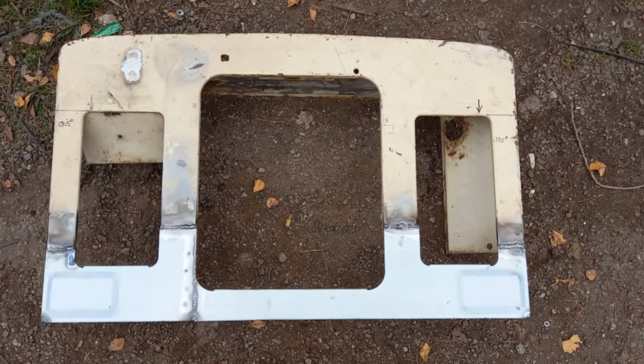And here it is. As you can see, we've got all four pillars welded and it welds around the 90-degree bend as well. And if you look down that second pillar, we put the spot welds back in. Now, the way you do the spot welds, really simple. Where you drill the holes through in the beginning from the front, you weld it through the back to the new repair section again. And that's basically it. So I welded this both sides. I started on the front, welded everything up, and then welded from the back.